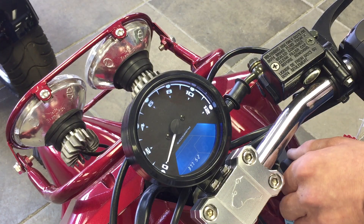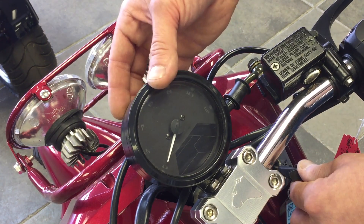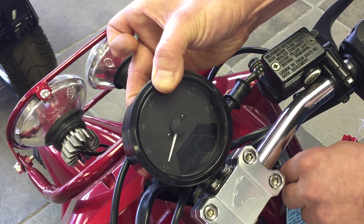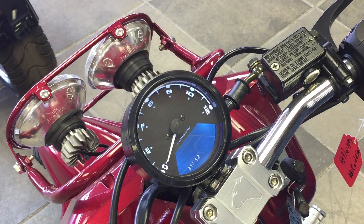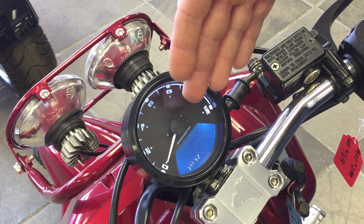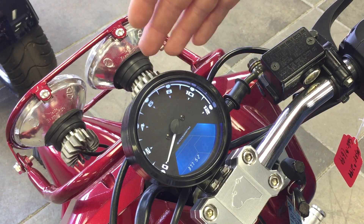Release, then turn the ignition off. Press and hold the button, then turn the ignition on — pressing and holding firmly. If the number is accurate this time — like it is, showing 377 52 — you've accurately adjusted your speedometer. Now it's dialed in.